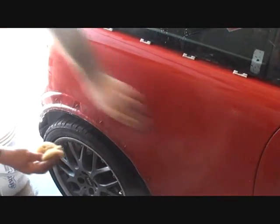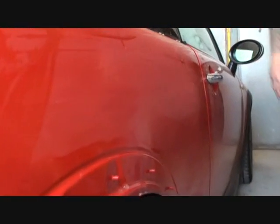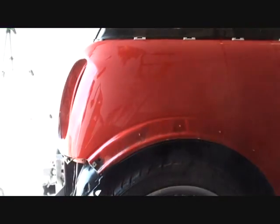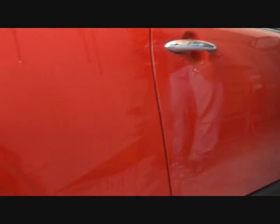We're going to take some fresh water out of our bucket, wet it down, and squeegee at the same time. If you watch very closely, you will see that the finish is now dry. Get down on it — paint ready. Do you see the difference? You can see that the finish has been completely dulled down. Look at the difference — nice and shiny over here, versus this area which is now paint ready, clear ready, ready to go. It has been thoroughly cleaned — all the wax and grease has been removed. This has been done in real time to show you that with the proper tools and proper knowledge from Pete, Rich can get it done.